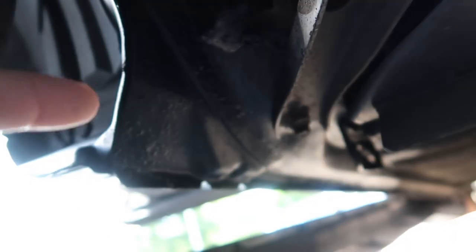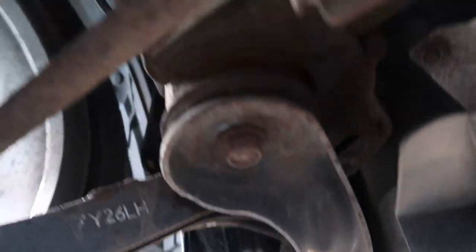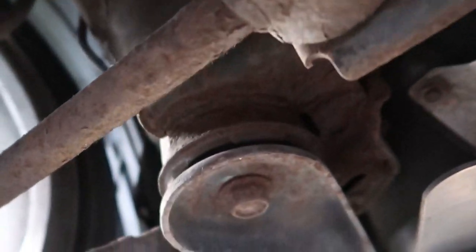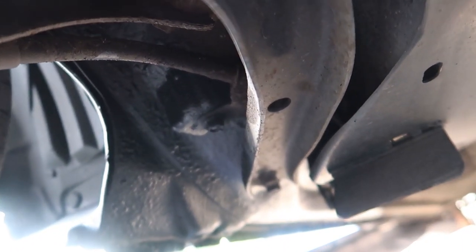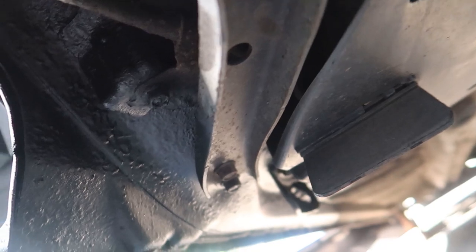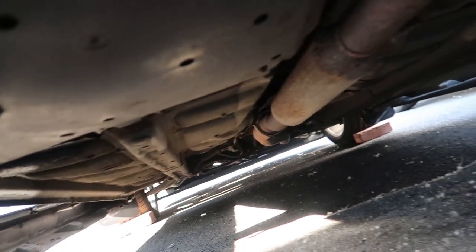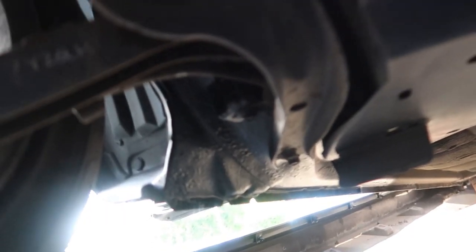The problem is you'll see people hitting that with a wire brush for a couple of seconds and then chucking some under seal over it. Because it's got such a forgiving finish with regards to corrosion you won't even notice. But look at this - this needs rectifying. You need to fix them all up, it's time consuming. That's why people will just chuck undercoat all over it and think it's all good, but what you don't realize is it's still rotting underneath. We'll get there - we're going to restore this baby to its former glory.